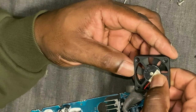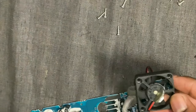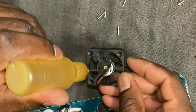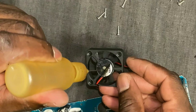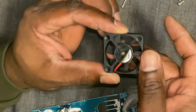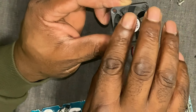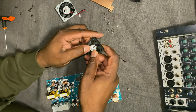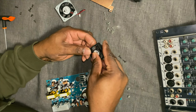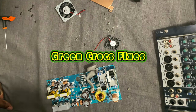I'll just give you a close up here. If you peel back a sticker on the back of the fan blades, there's a bearing. All I'll do is put a couple of drops of oil onto the bearing in the middle, then just give it a little spin. And then it's just a matter of putting the sticker back over — it should hold the oil in. I'll just peel that sticker back over. I've done it to both fans.